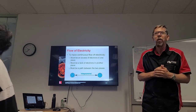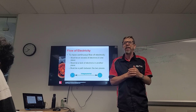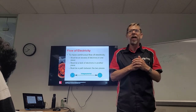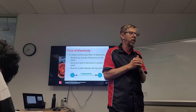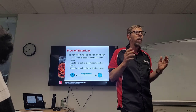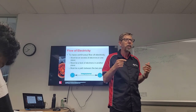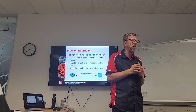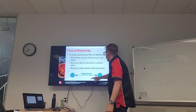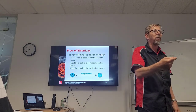You'll hear me as we go on talk about doing our voltage drop test, and we've already talked a little bit about that in alternators, but we can't do a voltage drop test if we don't have current flowing. It's useless, okay? Also, when current doesn't flow, and we'll learn a bit more later, it gives us some advantages when we're testing different circuits, because if we don't have a complete circuit, we will have voltage at the other side of the resistor where it doesn't go to ground.